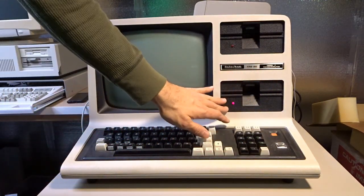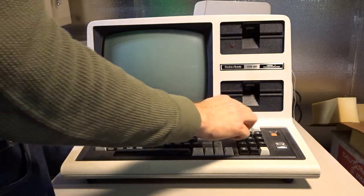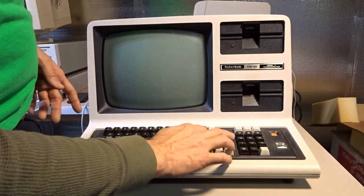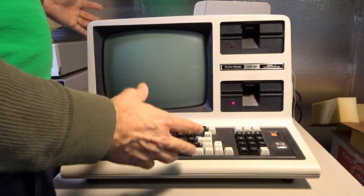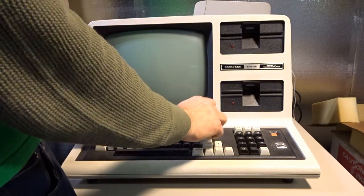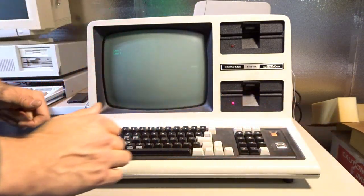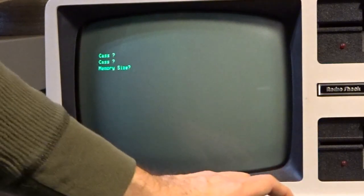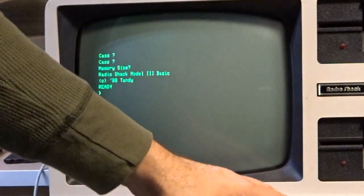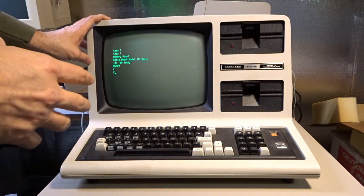When I hit the reset button, the floppy drive seeks. I don't have a floppy disk to put in to try. When I hit reset it tries to boot again — that's a good sign. I held down Break to escape the boot loop. It says 'Cassette?' — hit Enter — 'Memory size?' So when you boot a Model 4 without a floppy, you fall through to the Model 3 BASIC prompt.